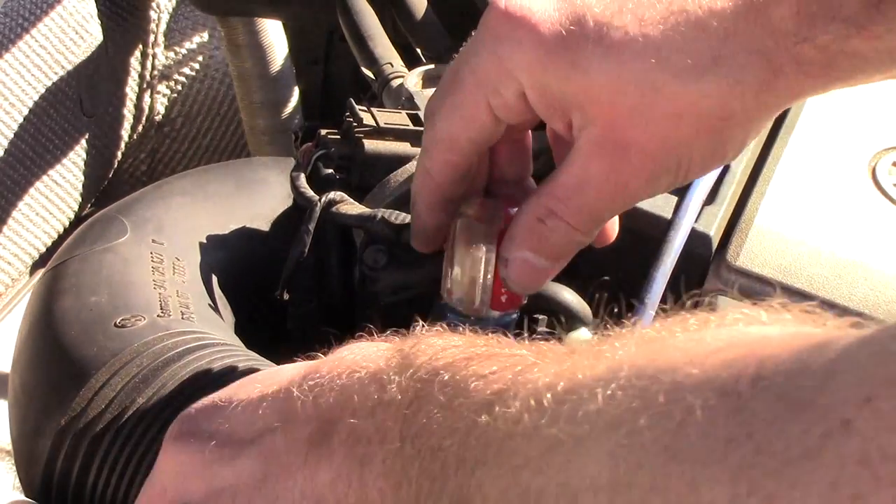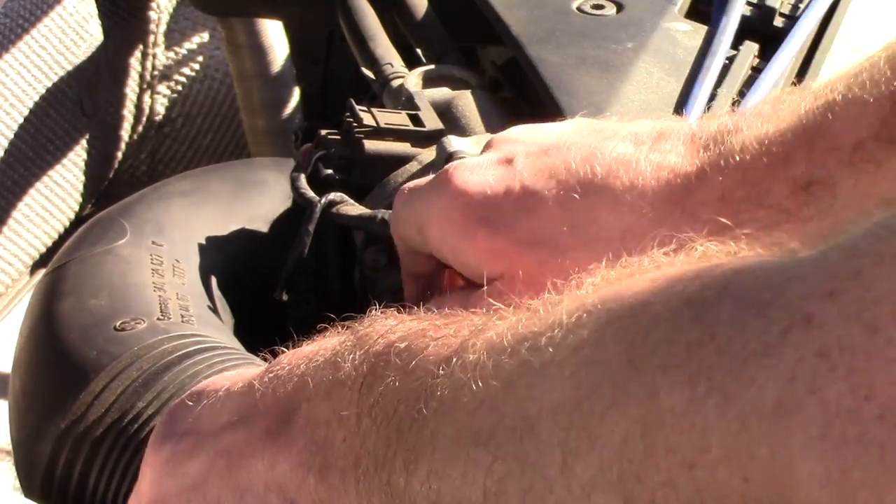During the process, I didn't see much smoke from the tailpipe and the vehicle didn't really misfire. I expected plumes of smoke but got barely anything. After the can is empty, pull the straw out, put the intake boot back on, and re-secure everything. I then pulled that same spark plug to compare before and after. There's still a lot of carbon on top of the piston and the spark plug is still pretty nasty, but the carbon that was previously dry-looking is now wet — which suggests the product is beginning to break it down, and more may come loose as miles are added.